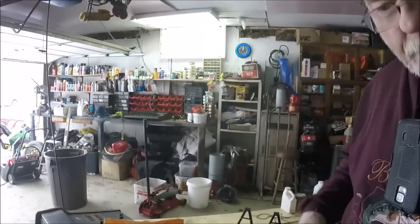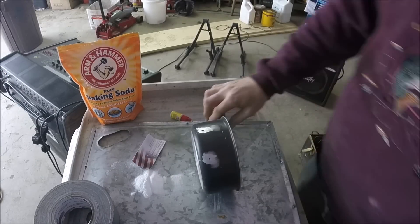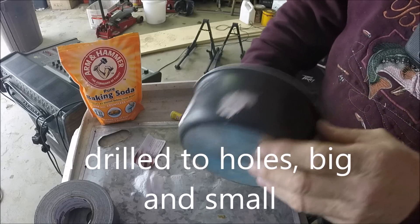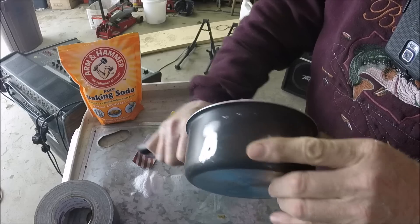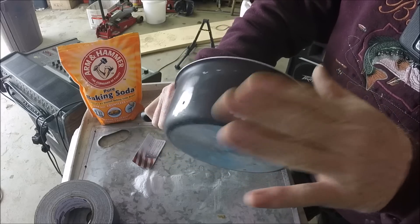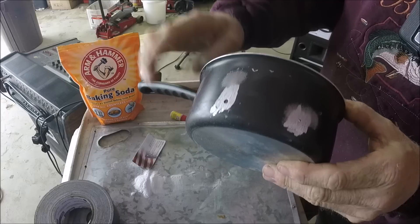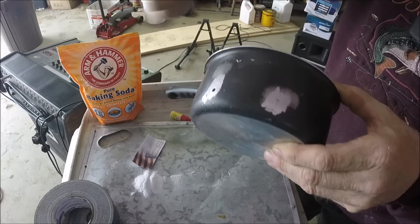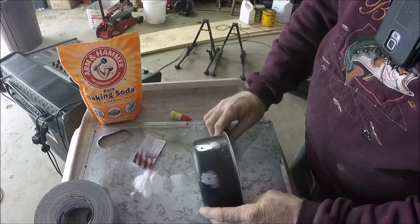What's up YouTubers. I said I was gonna make a video where I try to simulate fixing a radiator or heater core. What I did was take an aluminum pot from the Salvation Army. To get a good adhesion, I ground it a little bit on a grinder, then wire-wheeled it to get a really good surface so it sticks really well. If it was in the car I'd use a drill with a little grinder attachment.